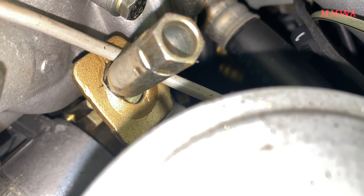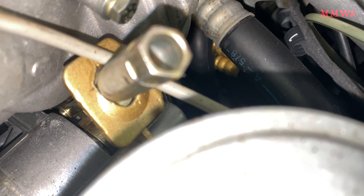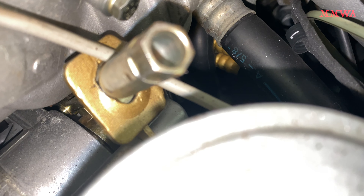So this morning before work I thought what better activity than rolling around on my back underneath the car disconnecting my fuel hoses from the fuel cooler that's underneath the intake manifold. I wanted to get these fuel hoses remade by an alternate supplier because the first group used hose that clearly does not last when exposed to fuel.